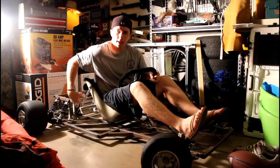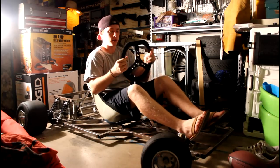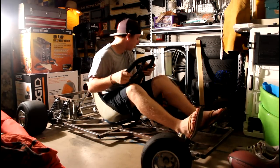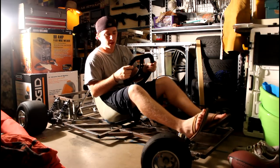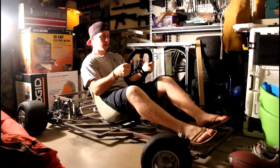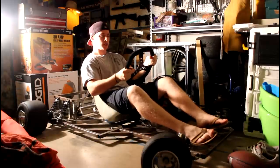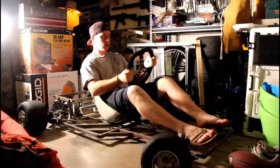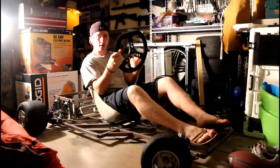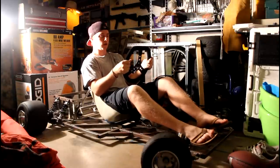These struts in the back will support the weight when I'm leaning back, and the strut in the front will support any weight if I'm braking or getting in and out of the seat. I was pretty pleased with that. Now onto the steering wheel position — I think where I want the steering wheel is right about here. It's enough room for me to move my elbows. I like being able to rest my elbows against the side of the seat and my thighs. So I think right about here is my ideal steering wheel position.